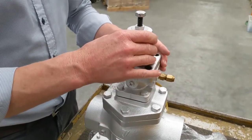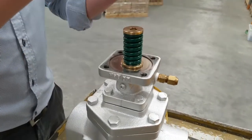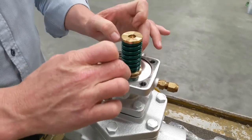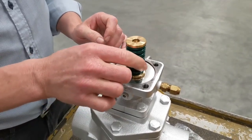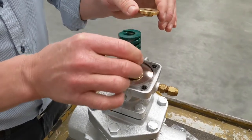When you're taking this off you just have to carefully take it straight up. Underneath you will see the spring with its two retainers sitting on top of the diaphragm. If you want to change the spring out, make sure you keep these two retainers.